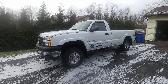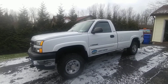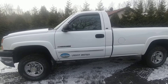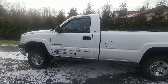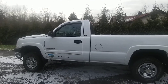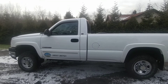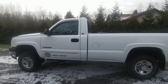That's the truck that I just added — a little quick walk around. I'm planning on putting a back rack on it pretty soon, as well as tow mirrors and maybe some other odds and ends just to make it a little bit more my own. Overall I'm very impressed with the truck. One downside is that it does not have the G80 rear-end locking differential, which has been a bummer for plowing. It's not a huge deal, but you can definitely get stuck if you're not careful. I do plan on having the rear end rebuilt either this winter or sometime next summer to accommodate a locking differential — just think it would be an overall good investment for the future.